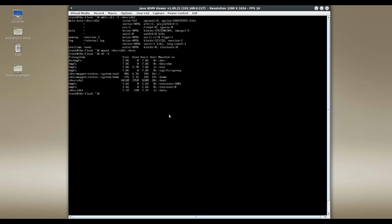Okay, so there's always a chance that some firmware on some hard drive just doesn't like to interact appropriately with the SAS LSI controllers. So obviously it doesn't make sense for me to test all models of hard drives out there for their compatibility, but at the very least it tells you that these controllers, even the older SAS 2008 and SAS 2308, have the capability to address the 4KN drives without a problem. Alright, so hopefully this video and the test I've performed just now helps you answer that question.